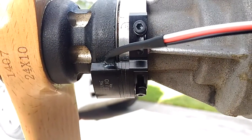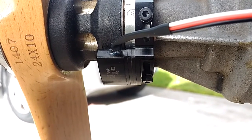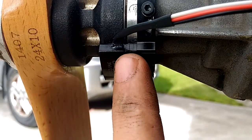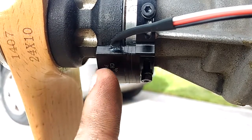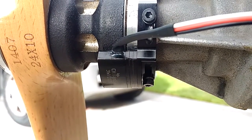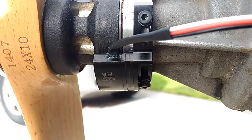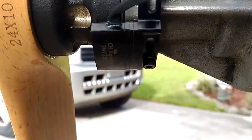This sensor holder is close to universal — it will work for 3W, ZDZ, and DA engines. As you can see, there are one, two, three plates. Those plates offset the main sensor holder to match the distance between the center of the mounting bolts and the center of the magnet, covering pretty much the full range of distances. It's made of aluminum, anodized black, so it fits nicely with the engine.